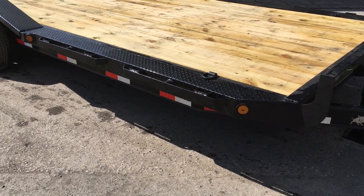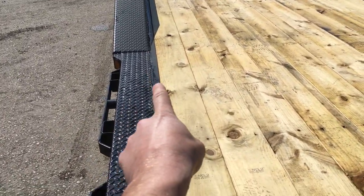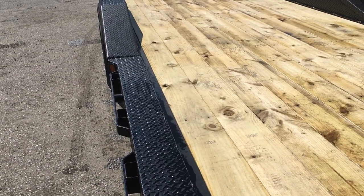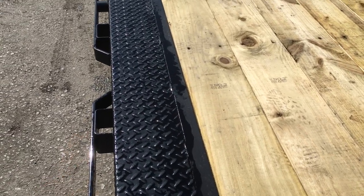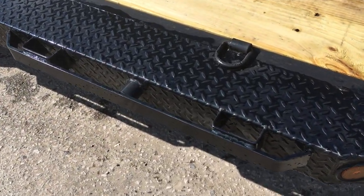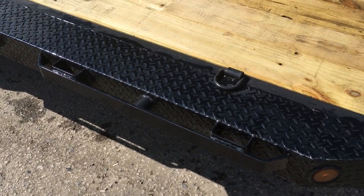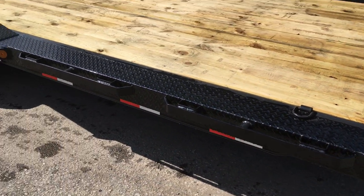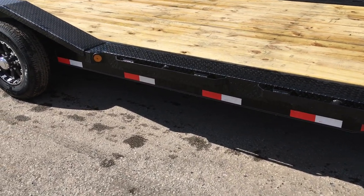This trailer is upgraded with a 102-inch deck. For those not familiar, you've got an 83-inch wide frame like your traditional trailers, then we've got the outrigger that's going to take you out to 102. Your actual deck is about 96, and then your rub rail and whatnot is going to take you out to the 102. Between each of the stake pockets and rub rail, they're going to put a chain spool or a pipe spool, so you've got additional places to tie down. They've also got the D-ring tie-downs as well — lots of tie-down points. These trailers are powder-coated, and of course you've got your reflector tape as well.